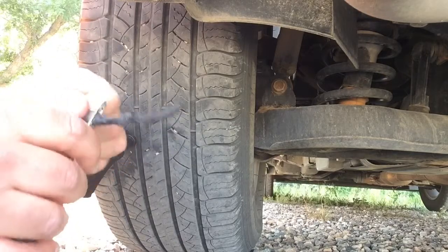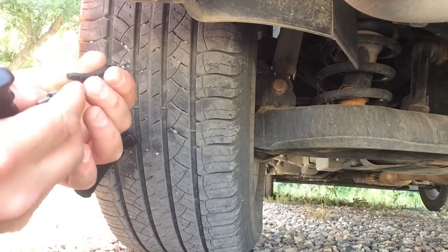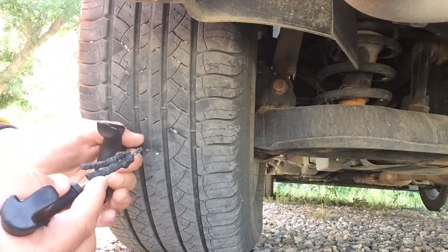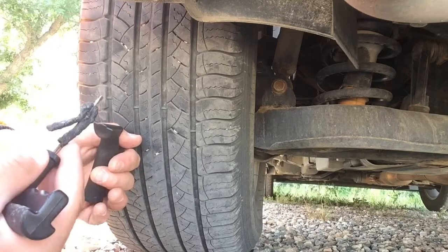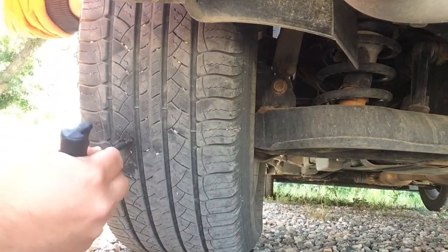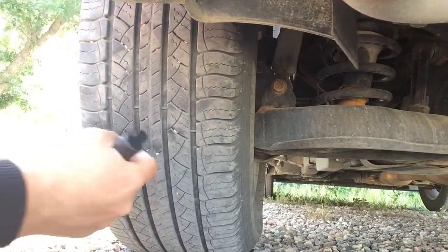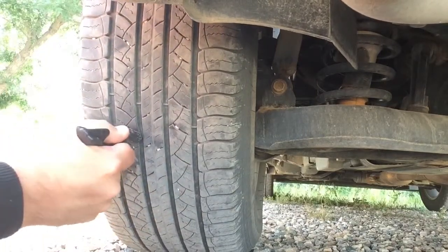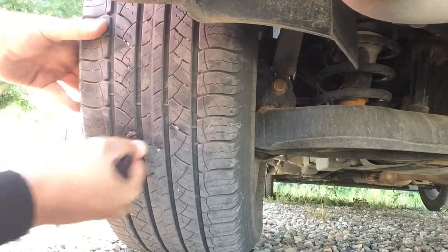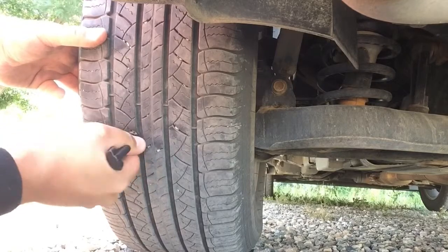These things work better when they're not straight out of a hot car. They're kind of like a tar - a rubbery, tarish kind of thing - so it's actually sticking to the inside of the tire as I push. I'm gonna quickly pull this out and then jab that thing in there. Come on, get in there. I'll do it without letting out too much air. It doesn't work as well on a hot day, I tell you.